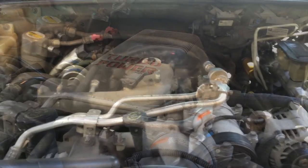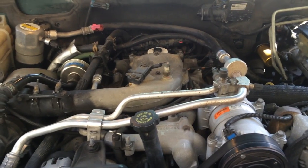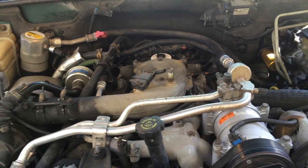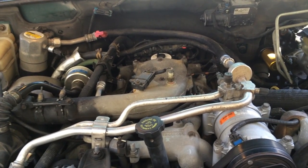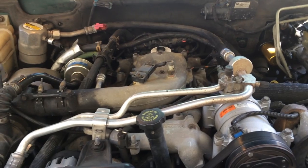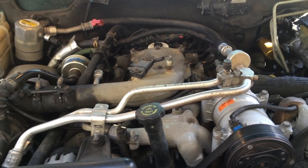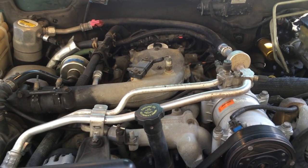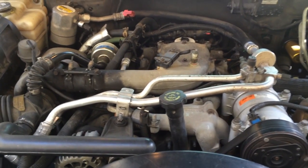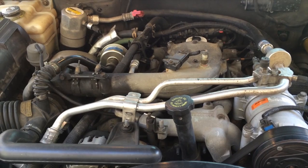We've got that shroud off. So we're looking at a diagnostic code P0236, which ties back to a problem with the wastegate boost pressure on the turbocharger. There's a system here we're going to walk through — any one of these components could be a failure point causing the powertrain control module to fire off that code. On a diesel engine, we've got no vacuum, so we need a source of vacuum to actuate that wastegate valve on the turbocharger.